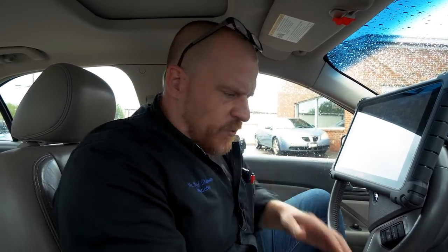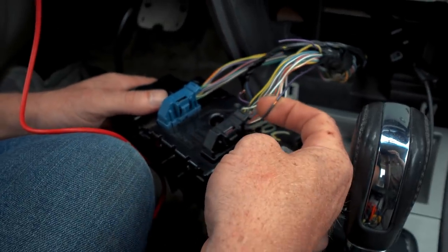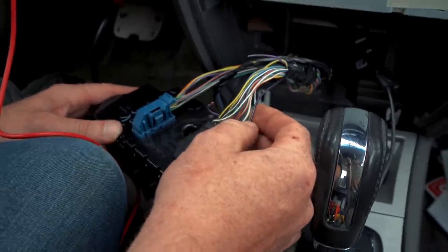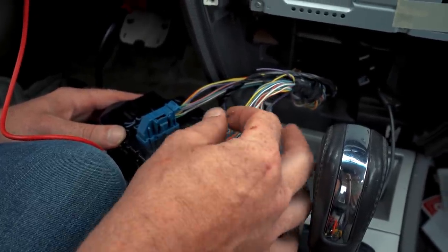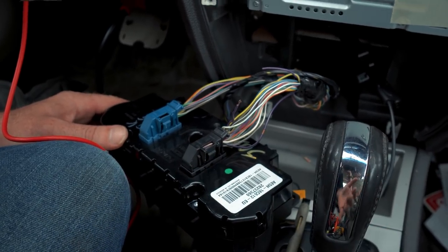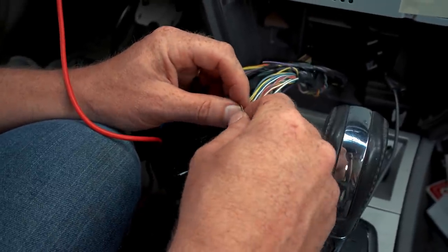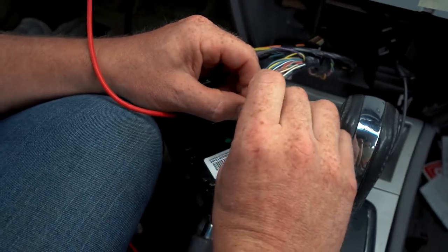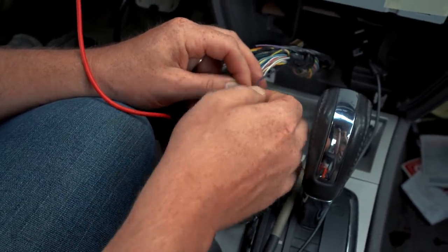I'm gonna put this back together off camera. I'll solder that resistor in. One more shot down here, Caleb, on where we're gonna do this. This is the main ground for the unit. I could have used sensor ground, but I didn't have the diagram pulled up for sensor ground. I have no problem using the main ground itself, because this is not really right anyway. And we're gonna put this resistor between the signal wire and the module ground.